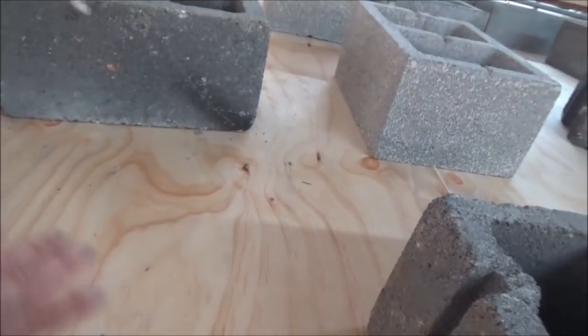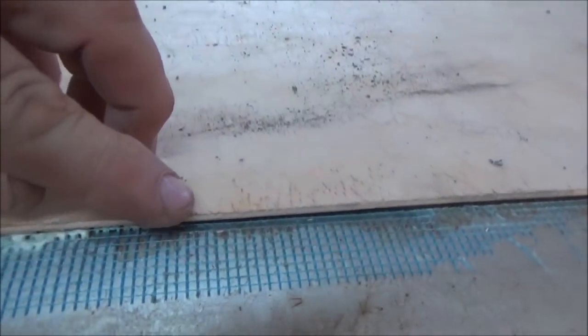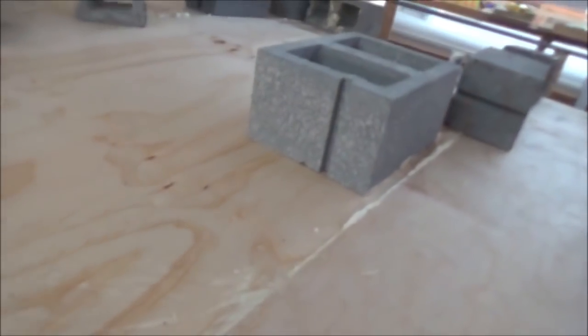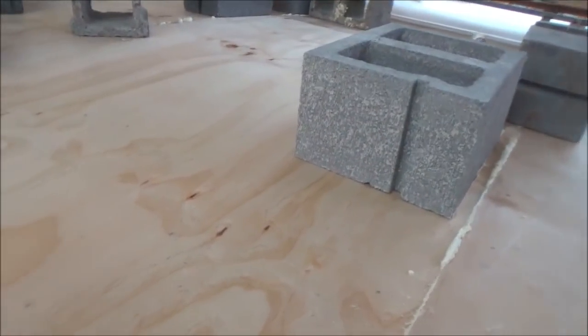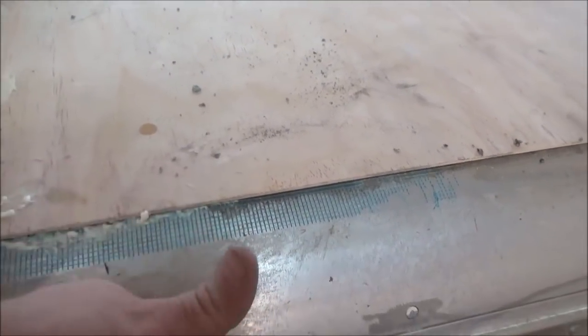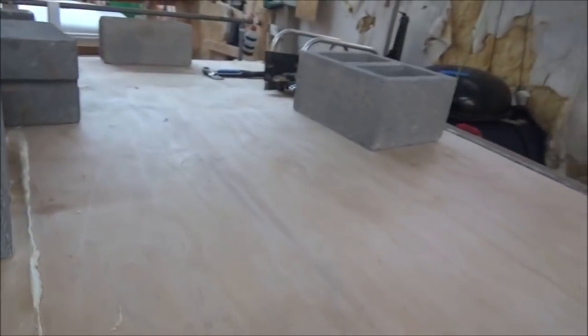If you notice there are no fasteners in here — we don't put fasteners in them. We glue everything back together the way it should be. Some other places just use staples. But up underneath this is just eighth-inch — that's all that is, the original deck is eighth-inch. I don't know what good a staple is going to do anyway. I like doing the blocks; it disperses more weight and keeps it more stable. And we never have to worry about hitting a wire. Sometimes these wires run anywhere through the foam — right under the original eighth-inch is foam, then another piece of eighth-inch, then the ceiling. So we just want to make sure we don't ever hit one.